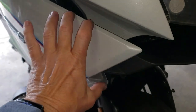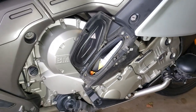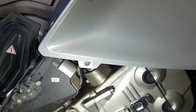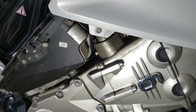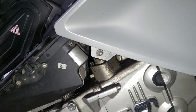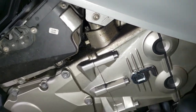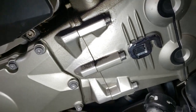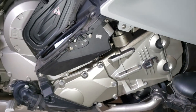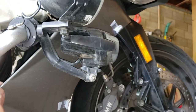I've got these two bolts off, and both panels will come off. So I have the first piece removed and it looks like I've got an oil leak. Anytime you're working on the bike, it's a great time to do a really good inspection and figure out what other things you might want to do while you're in there. Looks like it may be the cam chain tensioner — there's definitely a bunch of grunge in here leaking down onto the outside of the engine. So we now have yet another project to add to the list. Here are those two underside bolts — we'll take these off and this piece should come out.